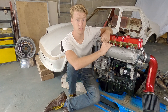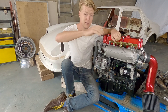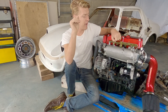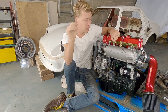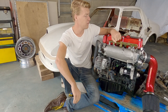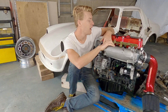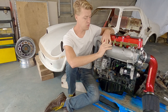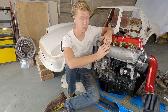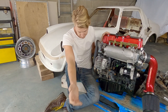I don't want to be spinning my back tyres up through third gear — this is a mid-engine car with a very short wheelbase and it's going to be twitchy enough anyway. This engine was 200 horsepower from the factory, and that's more than enough punch. It has a very long rev range, ending at around 8,400 RPM from the factory, so driving between 3,000 and 7,000 RPM on the road I'll have more than enough power to overtake any tractor or lorry on a B road. This particular engine has been gone over and is making considerably more — possibly around 250 to 265 brake horsepower, as it has Skunk2 cams fitted.